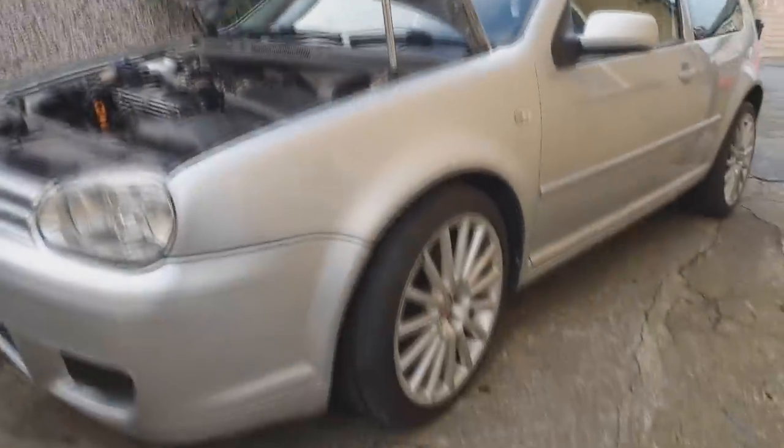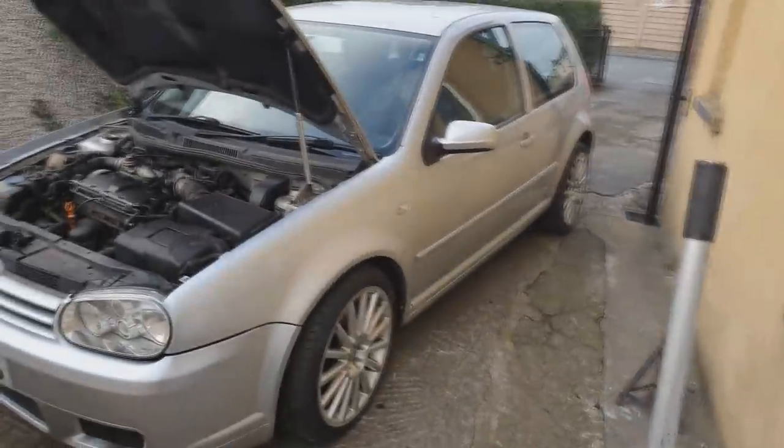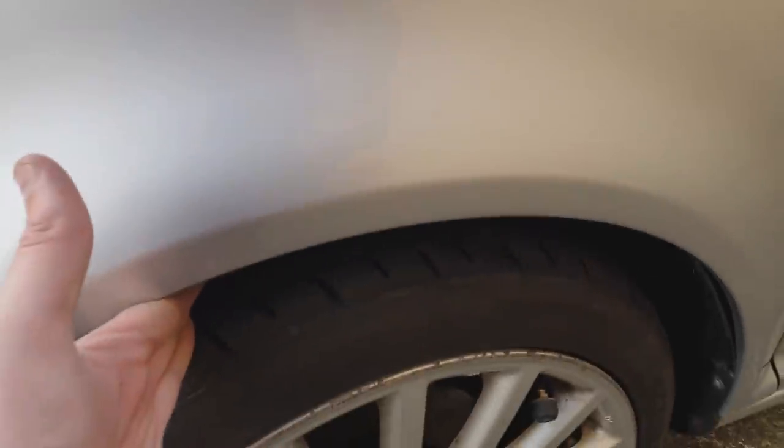I'll drop the front on the floor so I can roll the car forward and give more room for the rear. Would anyone like a sneak peek? It's still going to settle a little bit and drop lower. Looks good! We still have the rear to knock out — once the rear springs are in, the front will come down a little more as the rear is currently holding the body up. About two and a half fingers gap now on the front arch — it will drop a bit more when the rear springs go in.